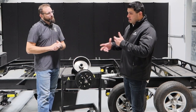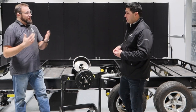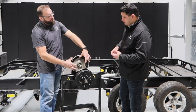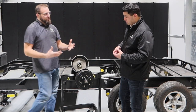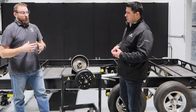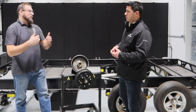Now, we've had some customers that will do 50 pumps — what are some of the problems if customers did that? So if you're hammering down on that lever or using a pneumatic grease gun, what's going to happen is as you're filling this greaser on the end here, that's going to fill this cavity and it can blow this seal out. If we blow this seal out, that's going to fill your hub full of grease. The way the brakes work is you've got two magnets that pop out and need to make contact with the face of this hub — and if you have grease in there, we don't have proper contact, so the brake pad is just sitting in grease doing nothing. What the customer will experience is that the unit won't have as great a capability of braking as it may have had in the past — they'll notice a reduced brake capability.